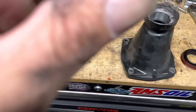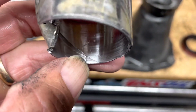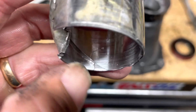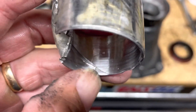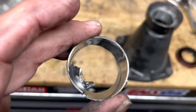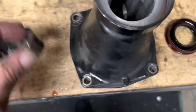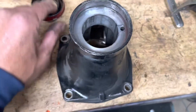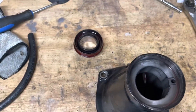Look right here at that groove right there — you can see all that material smooshed over. That's material from the bushing that was getting mushed over into there, so that tells you how much it was worn. I can't wait till Monday to get the new one, get it back in here, and get everything all back together on this piece of junk — get it ready for cruising. Getting closer. Tail shaft's off, bushing's out.